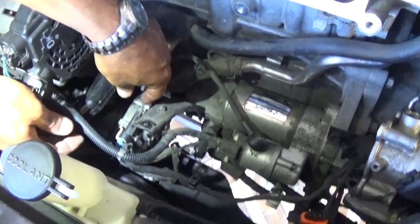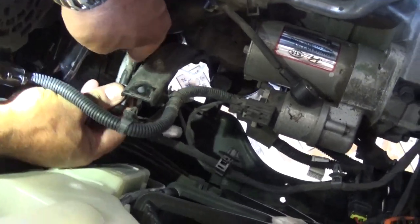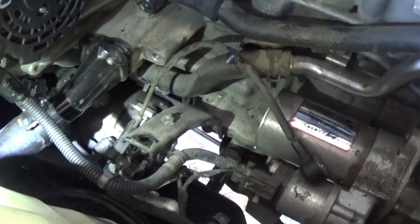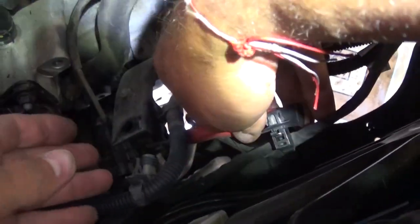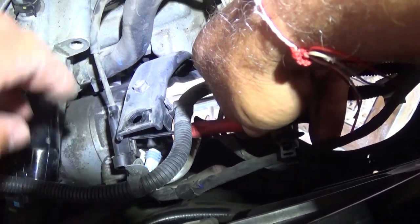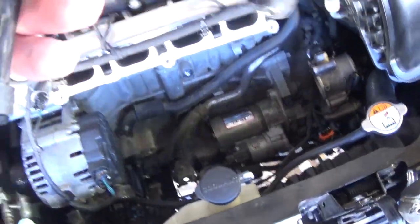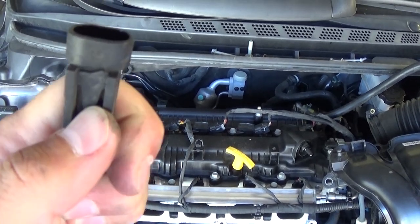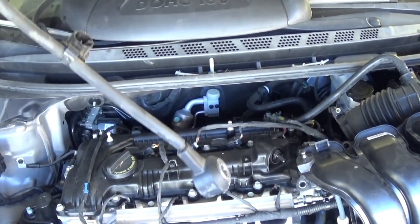It came out of the clip there. We will disconnect the wire here — on this one you have to pull the piece up and disconnect it, then disconnect it from that metal holder. On the inside there is one little round hole. Get a small screwdriver, press in, and at the same time pull it out. That's the tooth you need to disconnect — press in and pull the connector out. And this is your knock sensor out of the Kia.